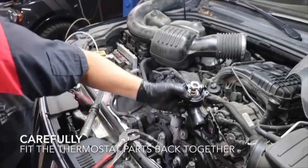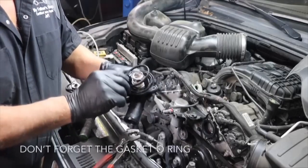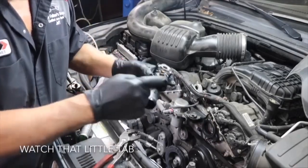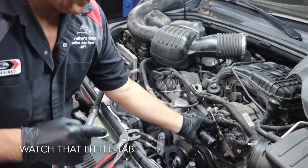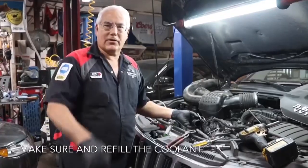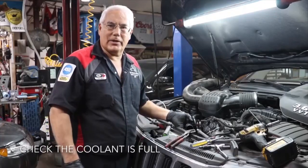That's the interesting thing about this thermostat. Then you replace the gasket, stick it back on, and be sure there's a little tab right here — don't break that off. Put it in there, twist it back into place, put the bolts in, and lock it all back together. That's the car care tip I wanted to share with you today, and as always, I appreciate y'all watching.